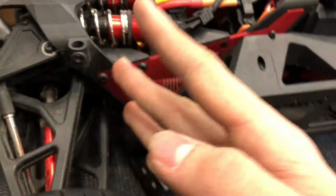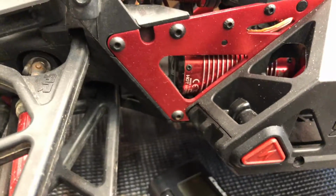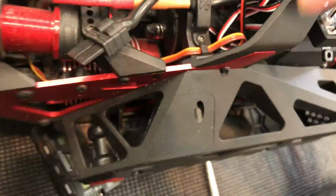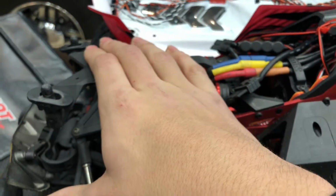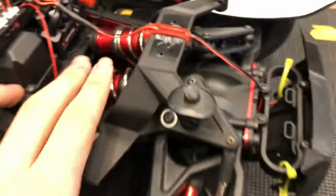They're really cool. Also, it's a really robust car, especially because it has two long plates. They look super cool with these holes cut in them, but I don't think it takes away too much from the structural integrity, especially because you've got this whole thing, which doesn't look like it'd be that stable, but this is actually the roll bar for all the electronics and components in here, and it does a phenomenal job, especially combined with the structural integrity of the rear shock tower. Sorry, I'm used to this being a shock tower. For the rear body mount and the front body mount, being mounted the way that it is, it's so cool. Not to mention, for robustness, they also put the shocks inboard of the car, so if you hit something, boom, you won't break your aluminum shocks.